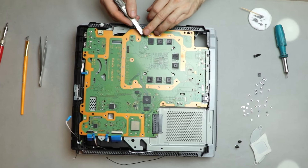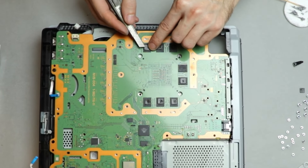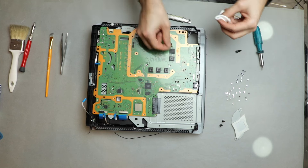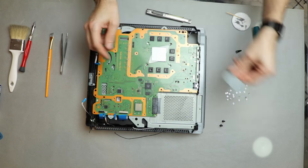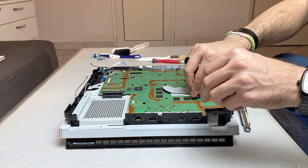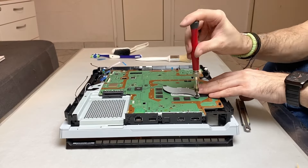As I said earlier, I almost lost two of the thermal pads, so be sure that all of your thermal pads are in place. I clean them a little with a bit of alcohol. Now I install the two metallic plates with the corresponding screws, screwing both at the same time by turning a few threads on one screw and then a few threads on the other and so on. This is a good practice for this step.